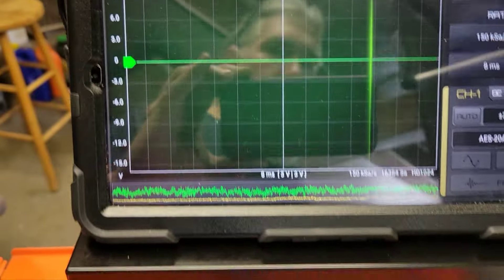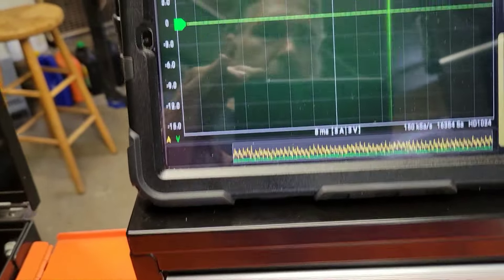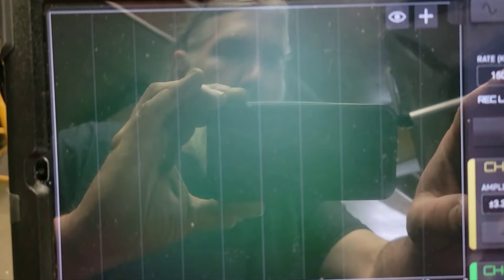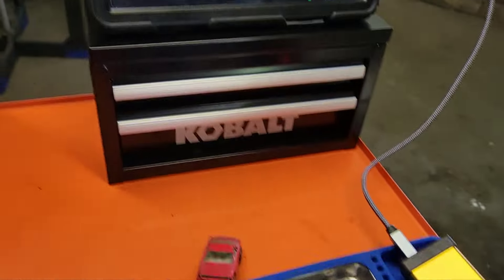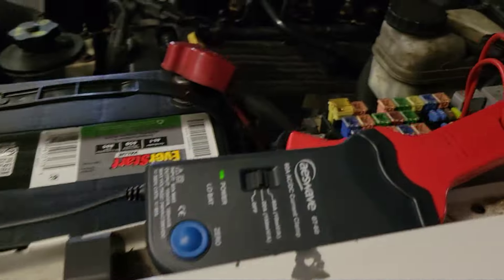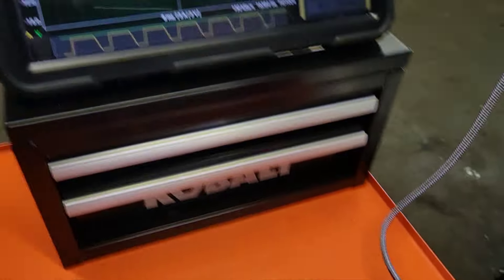Now I'm gonna turn the power on, put it on the 20 amp, and hit the zero button. On the automotive mode you have to start recording for the waveform to come up. So I have the clamp on there — I'm gonna fire the car up and let it run. It's pretty loud because it has a plug catalytic converter and I have the O2 sensor out of the driver's side on cylinders five, six, seven, and eight. I just want to make sure all the injectors are firing and get to use a couple new tools.